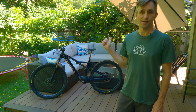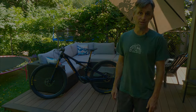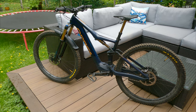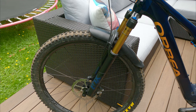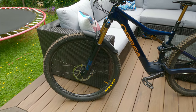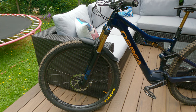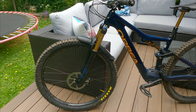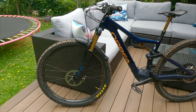Let's take a look at some of what's on the bike, the small changes I made, and maybe a few things I would do differently. This build has a 140mm Fox 34 on it. Some of the other builds come with a Fox 36 with 150mm travel. The head tube angle on this is currently at 66 degrees, which is a little steeper than I'd like — I'd love to get it closer to 64 or 65. I have an air shaft for the Fox 34 that I'm going to replace to boost it up to 150mm, which will put the head tube angle closer to about 65.5 degrees. I'll get that slotted in when I have the fork serviced next.